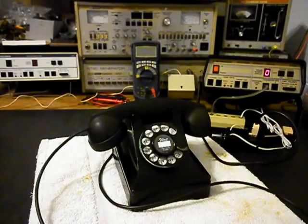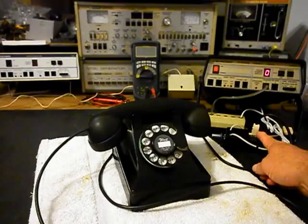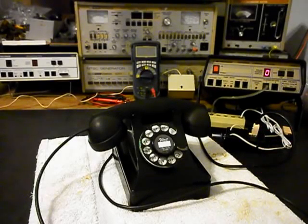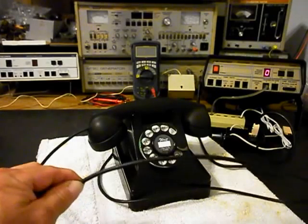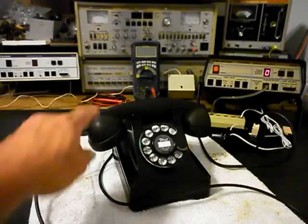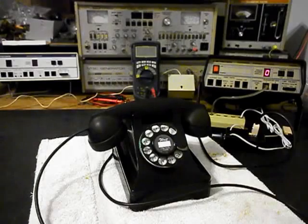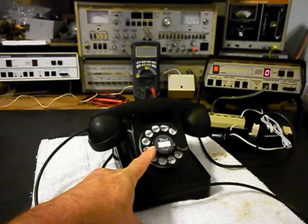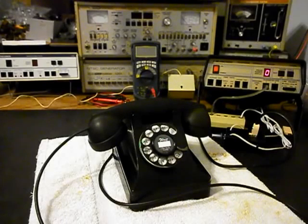We're back now, and we are finished up with the repair of this 302. We went ahead and installed our modular port adapter so that Patricia can walk up to this telephone and plug it into any modern-day jack, and we were able to save the original line cord. The handset cord turned out to be bad, so we talked to Patricia about that, and we went with a more period-authentic straight cord for the receiver. We also repaired the issue with the receiver capsule — the magnets were loose, they were stabilized, and that has been taken care of. We went through the rotary — it was oiled, cleaned, and adjusted. We also installed a dial center card and ring to the period of the telephone.